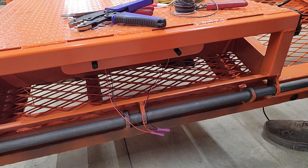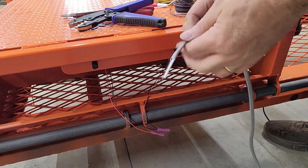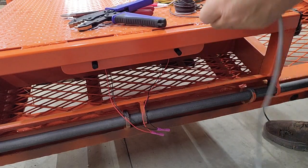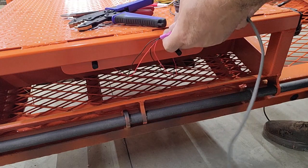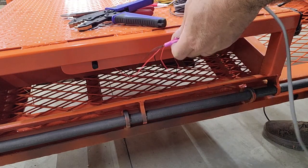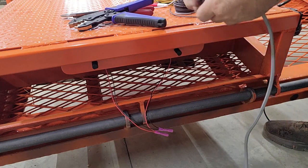So I try to stick with traditional DC methods. And I didn't have any 2-wire cable that had brown and white, so I have black and white, as you can see here. So I'll still stick with white being the ground. Somebody might say, well, why wouldn't you do black to black and white to red? Well, that's really kind of opposite of what, if you're in the junction box, I'm not going to know that there's red and black here. If you're going to be in the junction box, all you're going to see is black and white, and white's always ground.